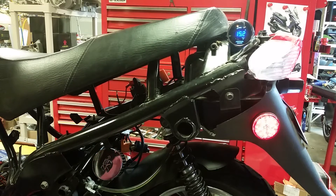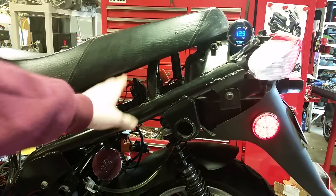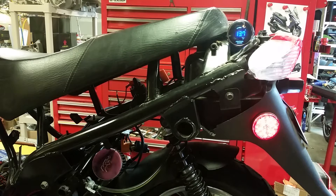I shouldn't have hit that throttle before the choke closed. These auto chokes are really pretty crappy — a manual choke is the best way to go. Now I've got to wait for it to level out. Alright, close enough, I think she's warm. In case anyone's wondering, my RPMs are right at a steady 1800. I'm staying real close to 14.7, bouncing around a bit. Let's check these high RPMs.